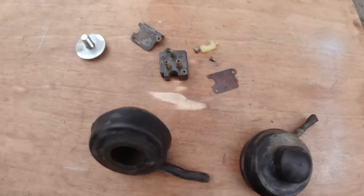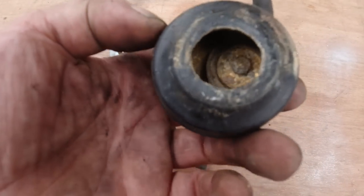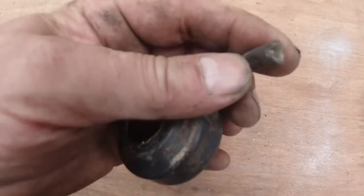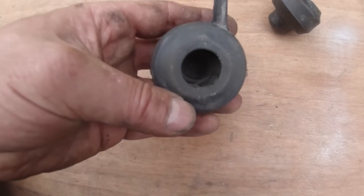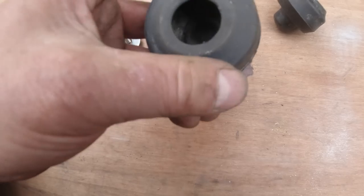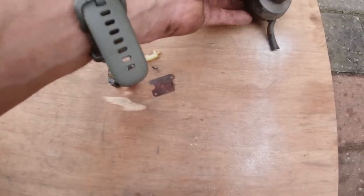Right, let's have a look at what we've got and how we're gonna fix it. So our original bulb, with the washer, the sealing washer inside it, broke away. And then cracking on the edges of it, but I thought there was a crack in this part. I can't see it now. It's a bit tacky, it's grubby round the end of it, but actually that'd probably go again. However, I got a newer one. This one looks nice, low mileage. I'm actually not so sure, this is one I got as new old stock. It's just never been fitted to a unit. Certainly got no cracking on that. So that's the one to use if you're going to do it. They're always handy too. I always buy these when I see them.